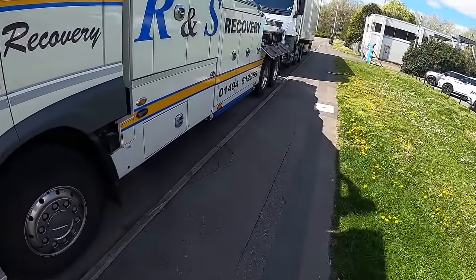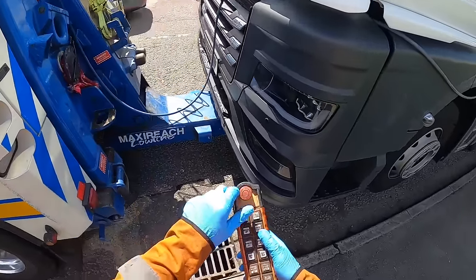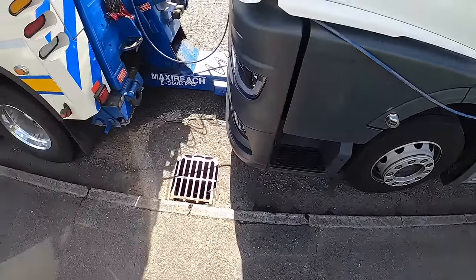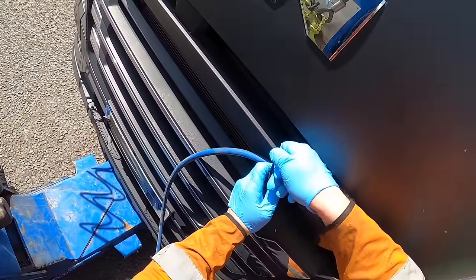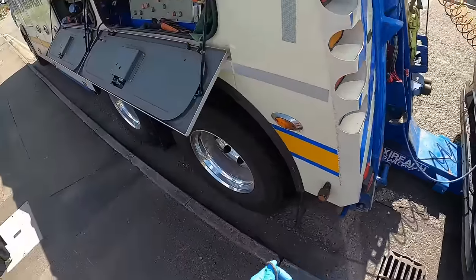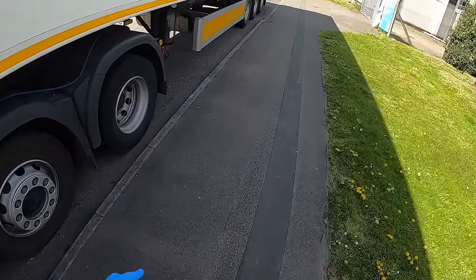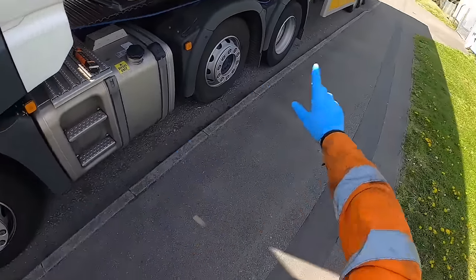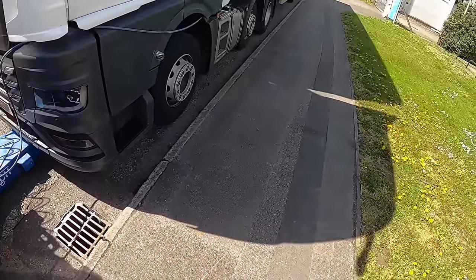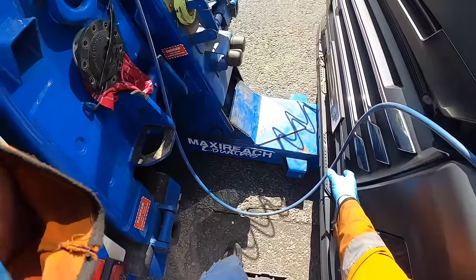We're outside MAN dealer now. The driver's just gone in to source another unit which they've repaired. We're going to drop the unit here and split it — it'll be easier for him to hitch up out here rather than in the yard. He's facing the right way and wants to go, so it makes it easier for me too. We've just put a couple of cones out because we're a little bit near the junction. I'm just going to put the park brake on the trailer, take the yellow Susie out and power it out, then uncouple and pull the unit away from the trailer.